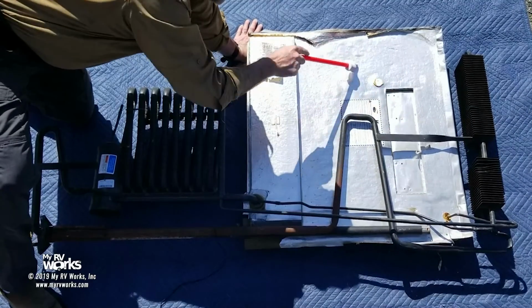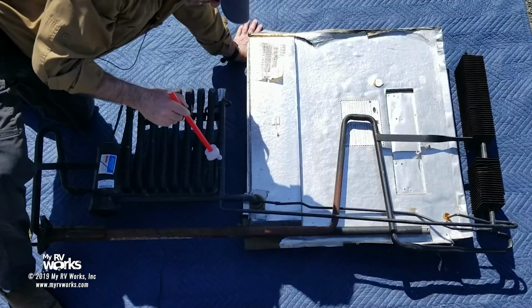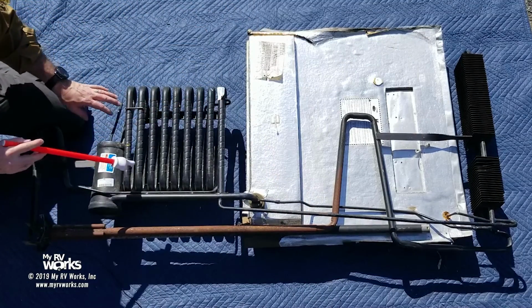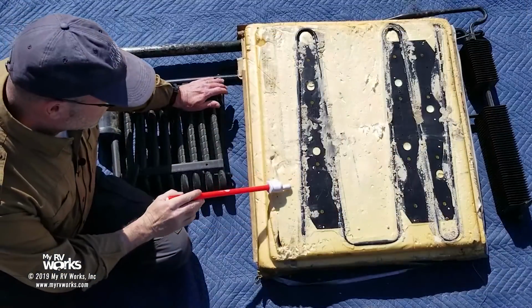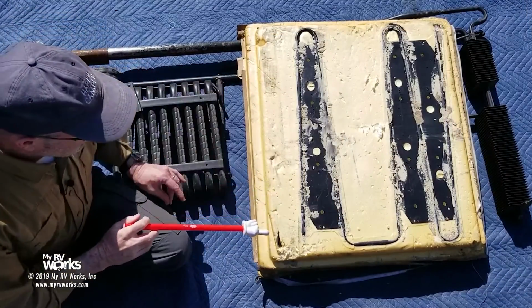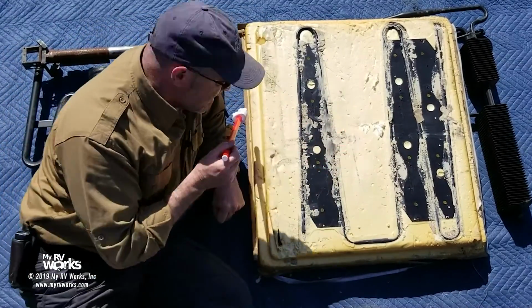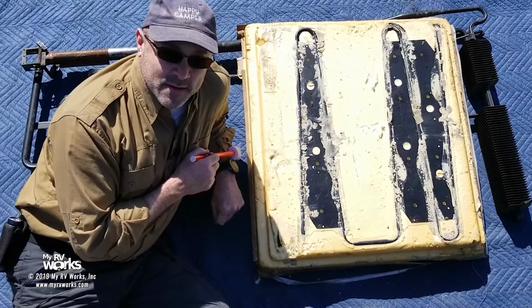This is your low temperature evaporator. This is your high temperature evaporator. These are your absorption tubes, okay? So I wanted to show you that now. Let me flip this over. So we flipped over the cooling unit, and what I wanted to show you, let me scooch over here. I'm going to lean against the absorber vessel. We don't need to know about him. We're going to learn all about him in a minute.